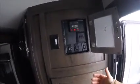If it does not light, this little fault light is going to light up, just to help indicate that it didn't light. It will try to light 3 times. If it doesn't light in those 3 times, it'll turn the fault light on. If you've changed propane tanks, or the unit sat for a length of time with the bottles in the off position, it may take more than those 3 tries to light the first time. So if you get the fault light, I would try it a few times to make sure it's not just air that's in the system.